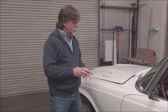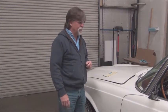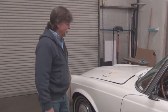This one has a hydraulic clutch, but it's obviously out of adjustment. The clutch never really feels like it fully disengages. It's fully engaged barely off the floor. The brakes seem to work okay, have plenty of braking power, but you've got a lot of pedal throw before they come into play. The steering is very light, it steers very easily, but it has a terrible turning radius. I can turn my long bed, extra cab, four-wheel drive Dodge pickup in the same circle as this thing will turn. Terrible turning radius.